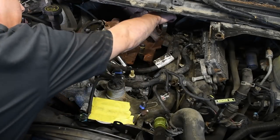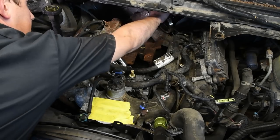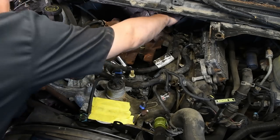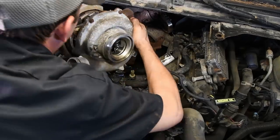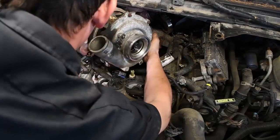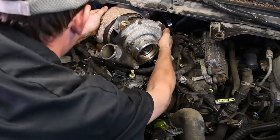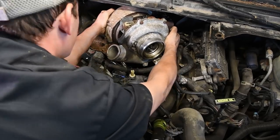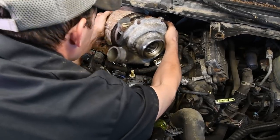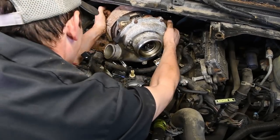Put the clamp on the up pipes. Kind of push it back out of your way. If you haven't done it in a while, it's probably a good idea to clean the turbo before you install it back in. I do have another video showing that. I'll put a link in the description below. But just sneak the turbo in, get the bolts started, leave them a little loose, and then get the up pipe clamp started.